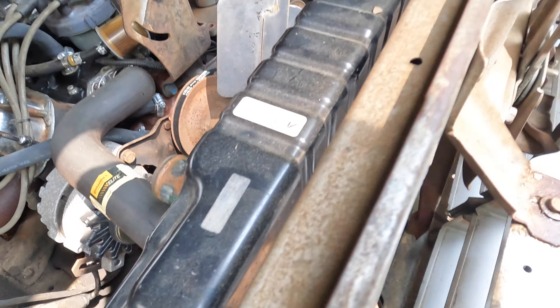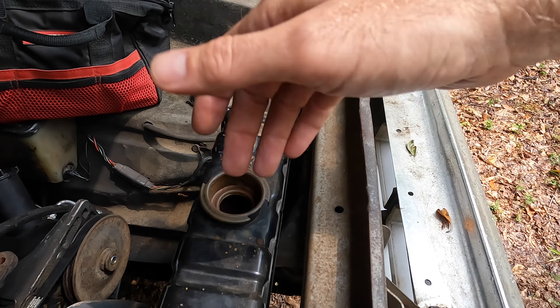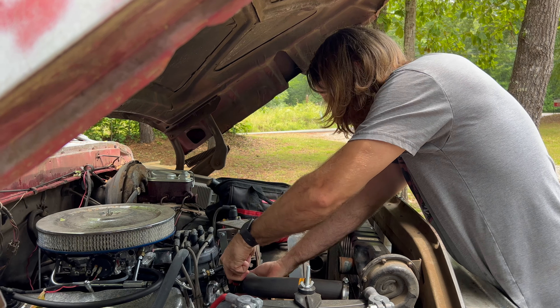If you measure this radiator it's much larger than any of the ones available. Looking down in here, you can see this flat spot — that's where the radiator should be mounted, about two inches this way and a little bit narrower. That at least explains why the radiator hoses weren't lining up. Now I've got the proper radiator, which helps move it away from the fan, gets some of those tight bends out of the radiator hoses, and the sizes should be more appropriate.